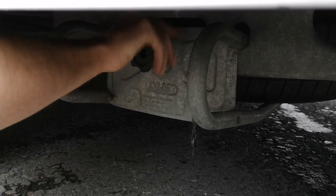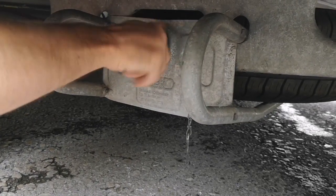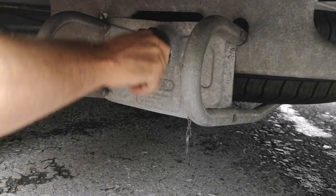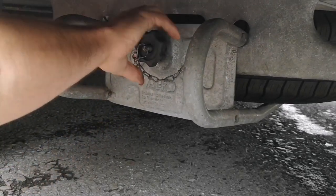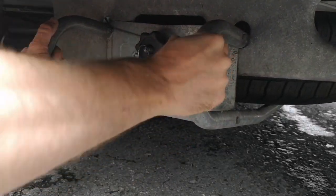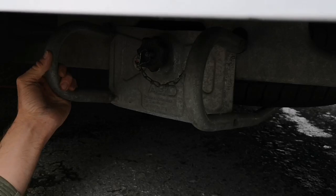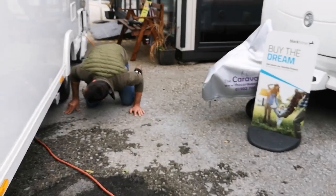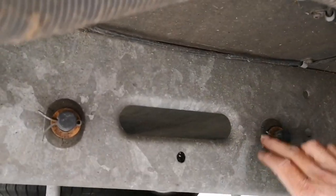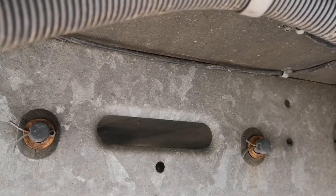Final things — locking nut on again, not overly tight but tight enough, and then the little pin just locks it into position so that can't come undone. Give it a bit of a manoeuvre just to make sure. It's worth checking the little bushes on the other side to make sure that as we've been pulling it around they're all still in location properly. Check that all the bushes are in properly, the cotter pins are in correctly — and that's all looking good, we're back into position.